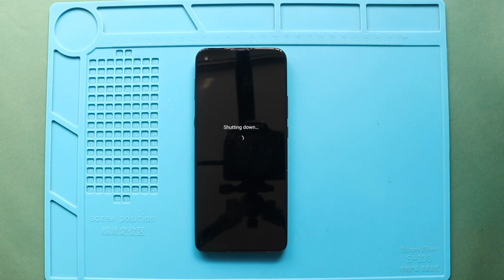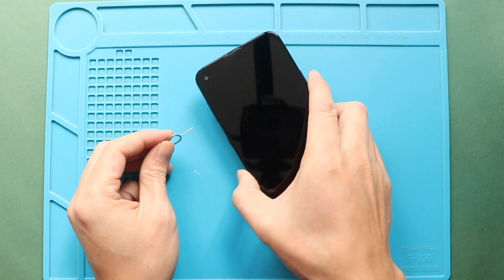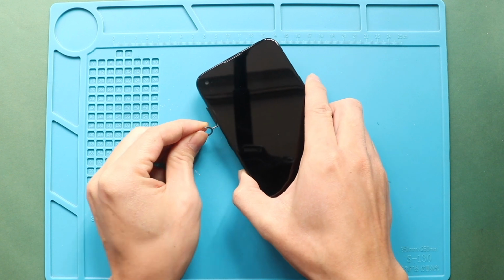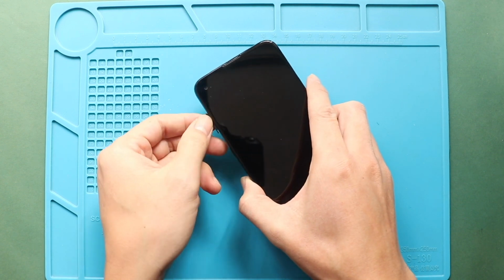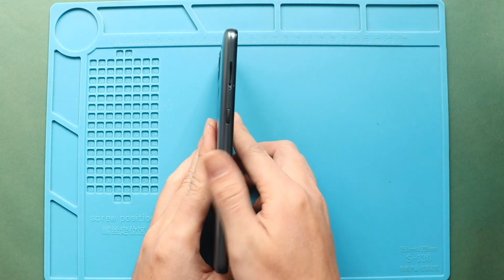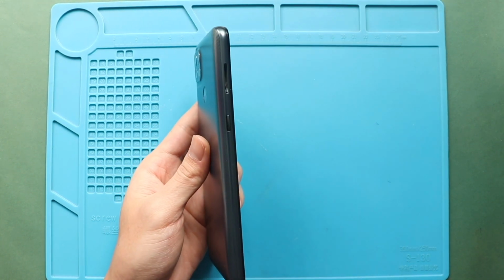Today we will show you how to replace a battery on the Motorola Moto G9 Power mobile phone. To start, we need the right tools to proceed with the repair, which you can find in the description. First, turn off the phone and remove the SIM tray, and then follow with the back cover removal.